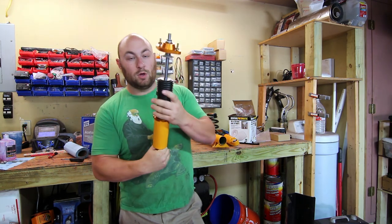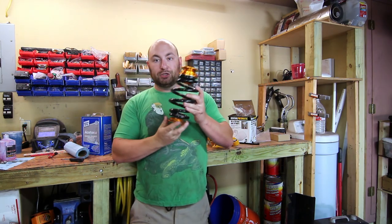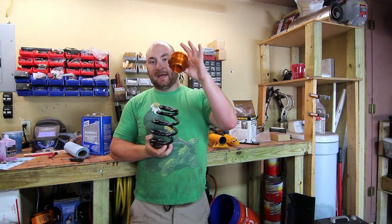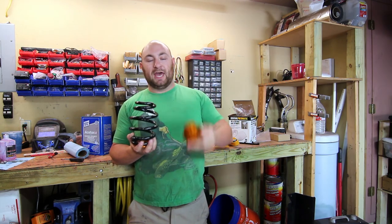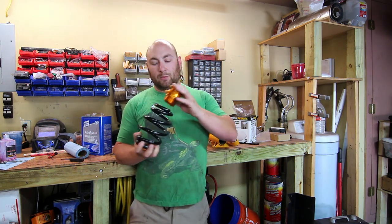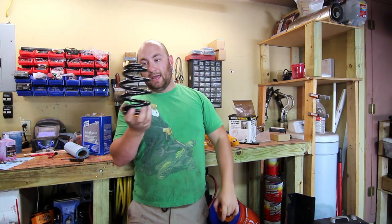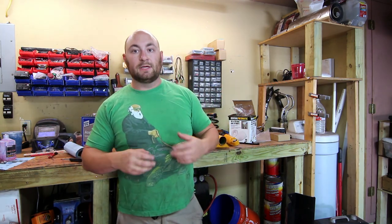There's a nice solid rubber bump stop — another feature I like to see in a quality product. The rear shocks aren't coilovers; they sit between the lower control arm with a lower perch, a beehive-type spring rated at about 500 pounds per inch, and a top hat that's adjustable for ride height. On the E36 it makes sense to put the adjuster at the top because it's easy to access when the car is on jacks. If you put it at the bottom you may have a hard time getting in there with a spanner wrench.